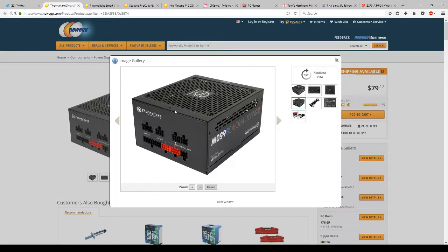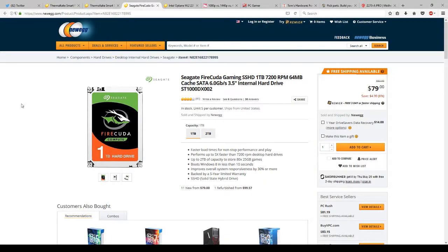Let's move on to hard drives. This one's been in numerous recordings prior. We'll get to that in a second. Let's talk about solid state drives first. A lot of the parts listed in other consultations, I have noticed that they are fixated on doing a RAID formation using solid state with a hard drive. The thing that these consultants get wrong more often than not is that when you RAID a solid state drive with a hard drive, it slows down the solid state.